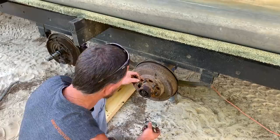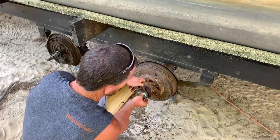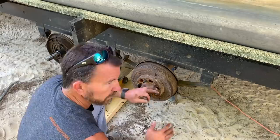That right there is going to be driven into this hub. You take a screwdriver and a hammer — you may need a hammer just to bump it down in between that hub and that shoulder to pop that cap off. Put it in your little bucket of gas. You need to keep every bit of this clean. If you don't have gas, you could use rags or starter fluid or whatever — just something to clean this stuff up to go back new with.